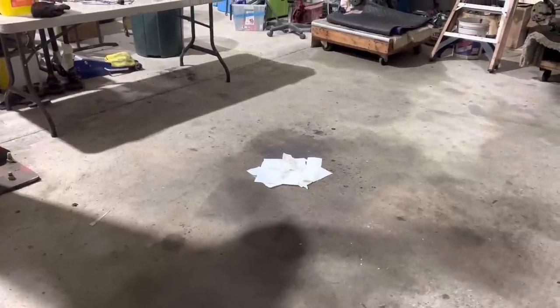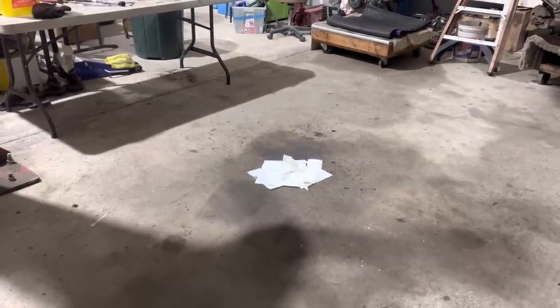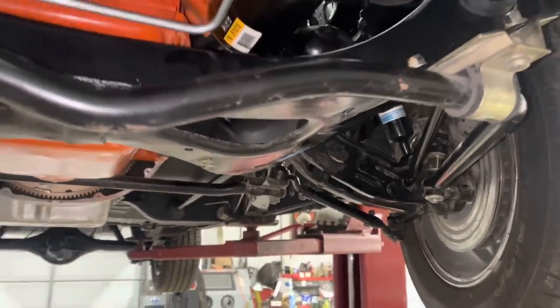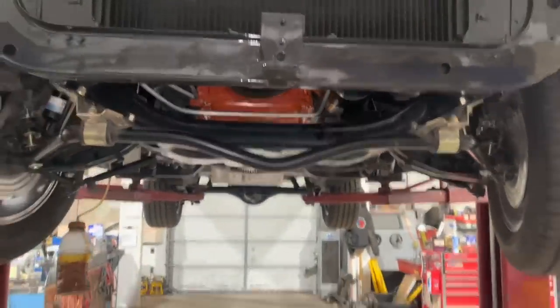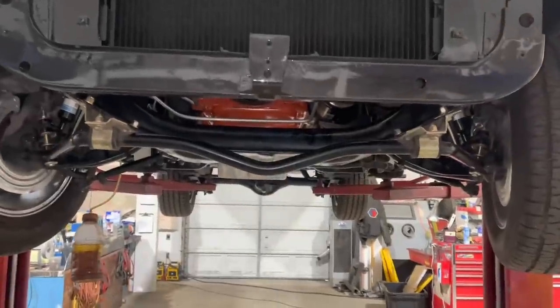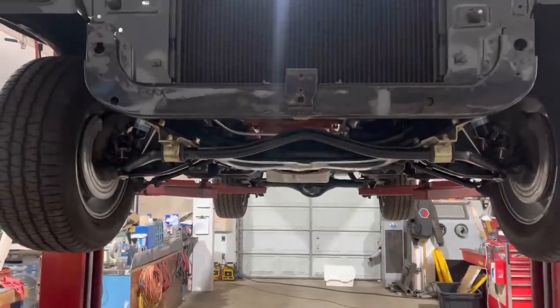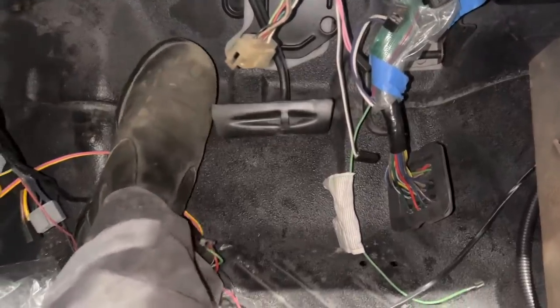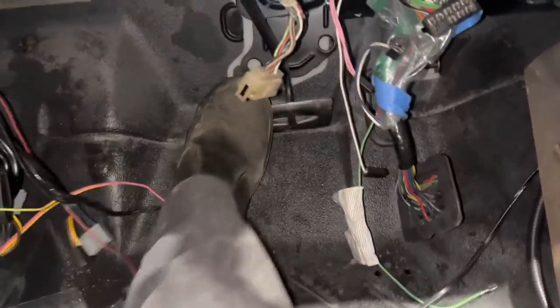When I said I tightened all of the brake fittings, obviously that was wishful thinking. I did find a couple more things to torque, like the lower ball joints. And if you hadn't noticed, I finally did — the sway bar's upside down. Much better. Now the big question: do we have brakes? The pedal's loose but it does something. Hole in your oil filter — not what you want.